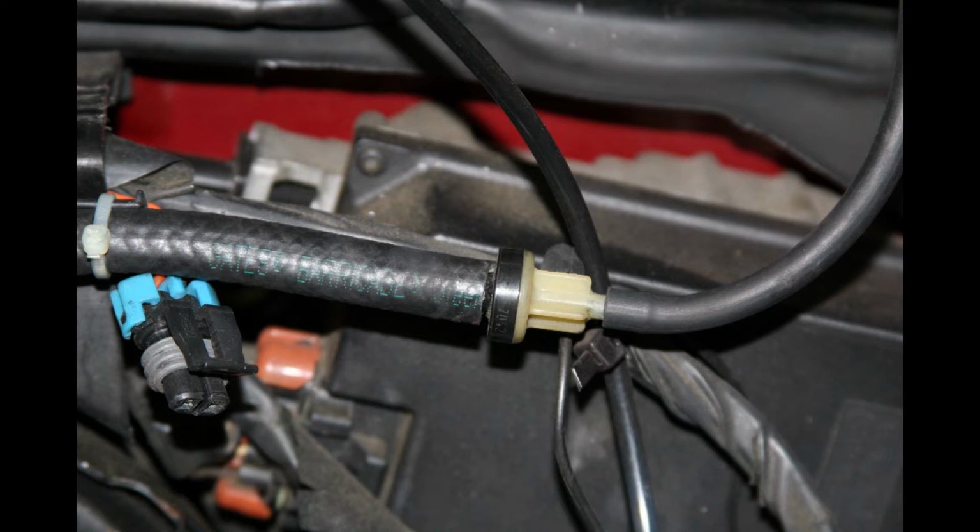If that fails, you will lose your intake manifold vacuum when you start up the hill, and the air will change from the air conditioning duct in the dash down to the floor. So that's a very common problem, always has been. To check a check valve, just put a Mighty Vac tool or blow against it with your mouth. You should be able to blow through it one way, but if you tried to suck back on it, you couldn't do it because of the check valve.